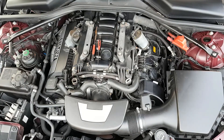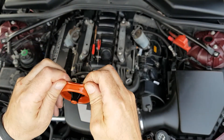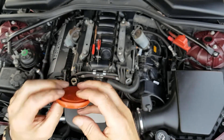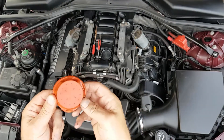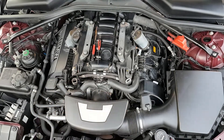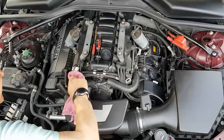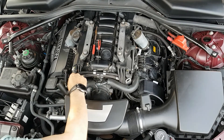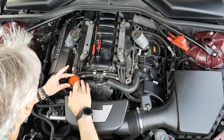I'm glad to see it's got no gunk in it like it did last time. I have a good look at the diaphragm — spread it out, twiddle it around, make sure there are no splits, not full of gunk. Turn it inside out and check the other side. That's a perfect PCV valve diaphragm, absolutely no problem. I remove the spring and give it a quick clean out — not much oil in there at all. Really pleased that after cleaning out the gunk a couple of years ago it hasn't come back.